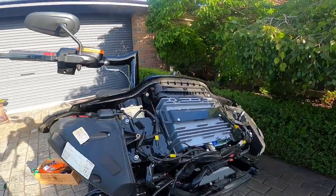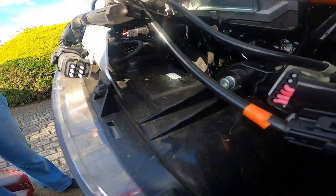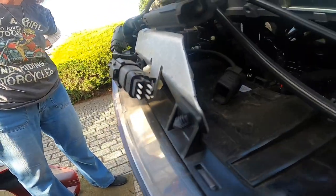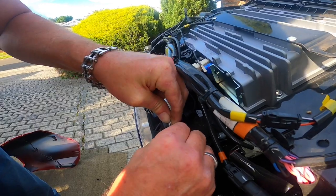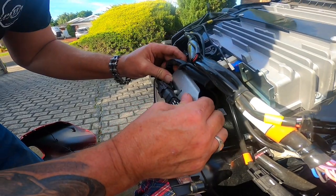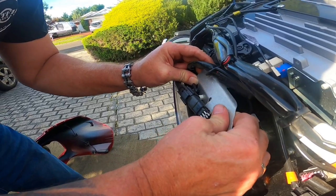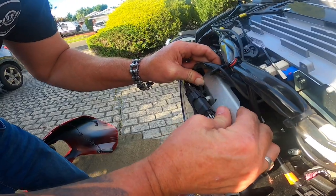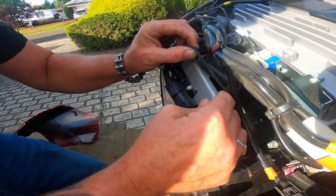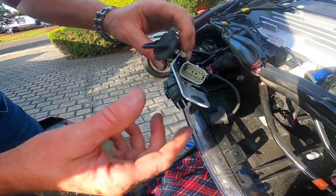So the one we're looking for — it's not this one at the front here. If you come around the side and go into here, you'll see there's a plug and that's what we're looking for. Just wiggle it a little bit at a time — it gets the little plastic holding pins to come out. Be careful so you don't break the pins, and away it comes, exposing our connection.